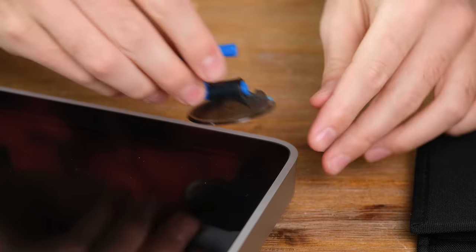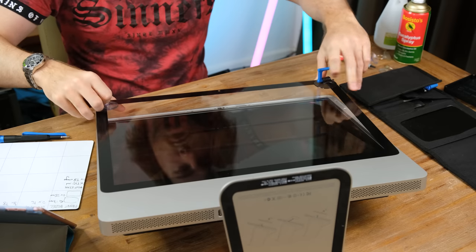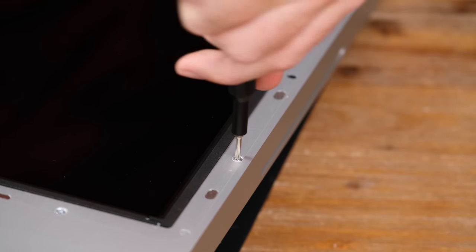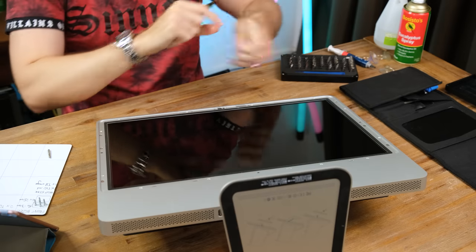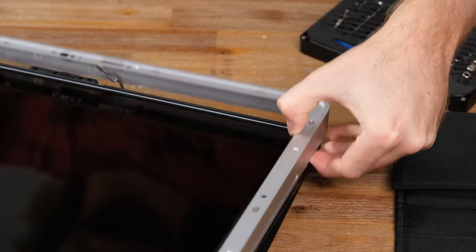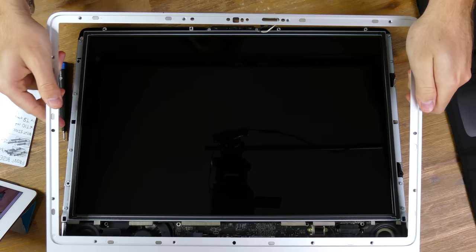Unlike new iMacs, the screen isn't glued in place. Magnets around the glass hold it to the frame, and this is pretty easy to remove with a few suction cups. And holding the front bezel on are a series of Torx screws, and I'm also following an iFixit tutorial that I'll link in the description below. I lifted gently from the corners, doing my best to avoid touching the fragile display surface. Be sure to disconnect the small microphone cable at the top as well.